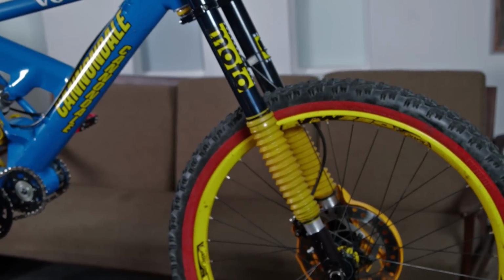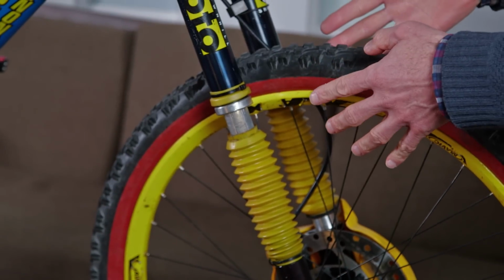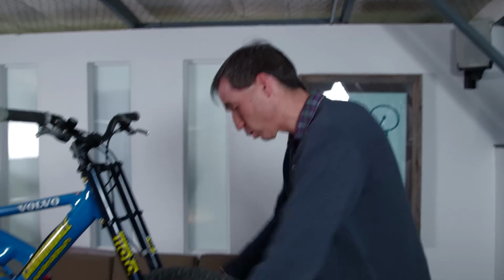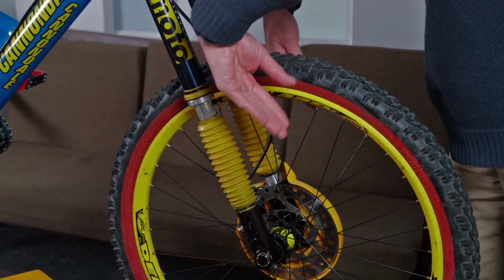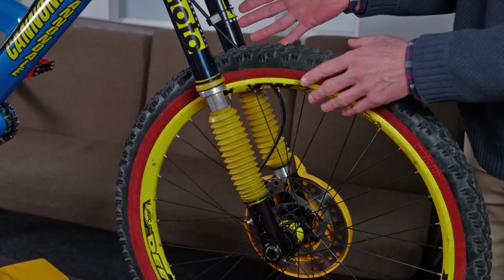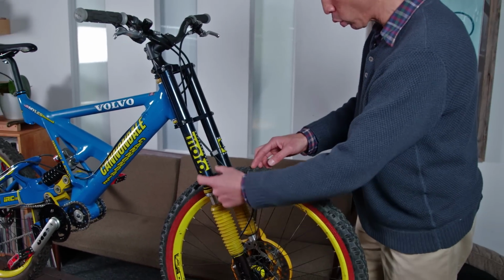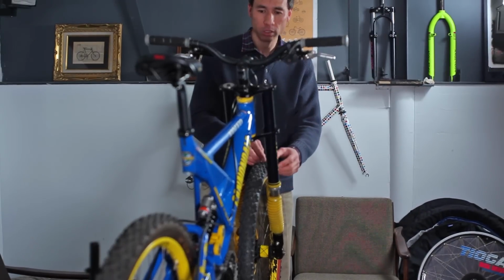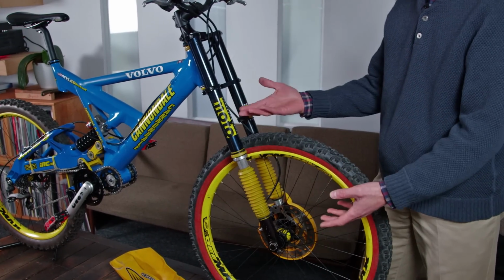Inside of the fork legs are these rows of needle bearings. So the technical advantage to this is, on a normal telescopic fork, you can have your lowers or your uppers that have that rotation, and so whatever your brake arch is really important to keep your axle from twisting. Here, each leg is providing that torsional stiffness to the axle. So your front wheel shouldn't wander too much independent of the legs. And so with this design, they realized at some point that there was so much torsional stiffness in one leg that they could just design forks and remove a leg and just go off of one side. And that's how the Lefty fork came out, which is still in production.